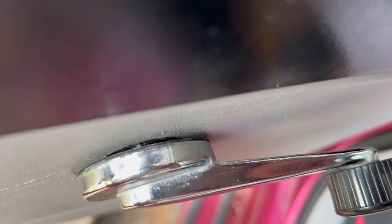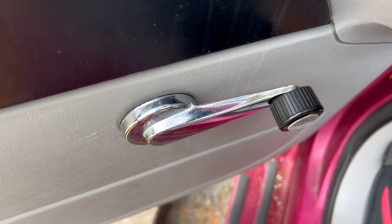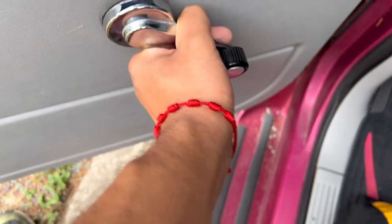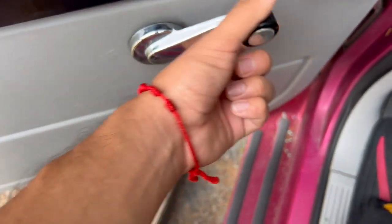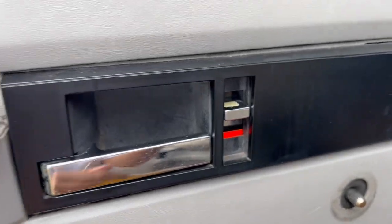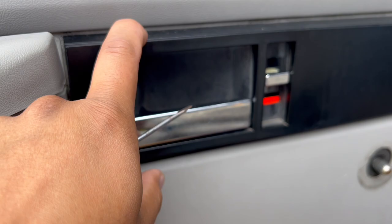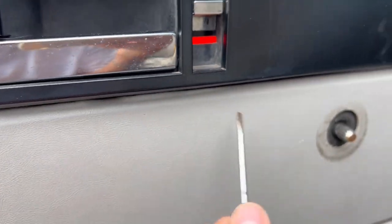It's such a hassle because if you lose the little clip you're screwed — the window crank will go in but it'll fall down while you're rolling it. I finally got it off and it just comes right off if it's not super stuck. You can put it back in easily right after taking it off, but over time it'll fall down. Don't lose this little pin. Also be careful taking out this little plastic trim piece because you can break off the tabs — it's really old OEM stuff so it breaks easily.